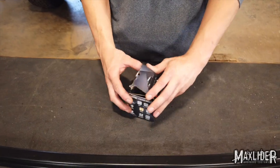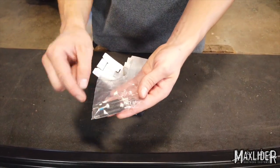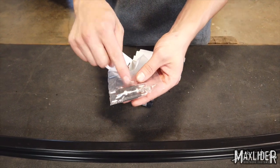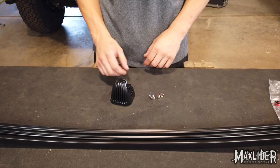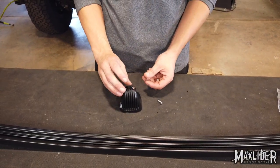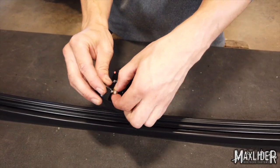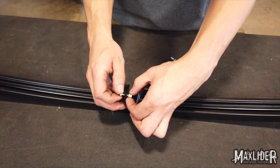You'll receive 15 lights with your windshield light bar. Inside the box we're going to get a bag that has our two bolts and nuts to mount the light to the light bar, an H-block which we will use, and then your light. Before we can put our lights onto our light bar we'll have to start these bolts in. They go in the back and then the nuts have these groove sides that will go towards the bolt — we just want to get these started.